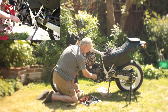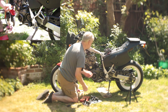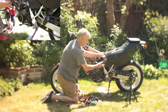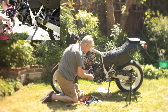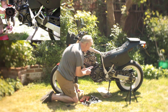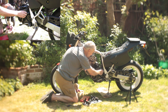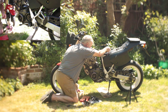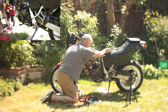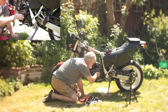I'm going to leave this stator cover off — actually I can put it back on now. This was also very crusty in here and I've put ACF 50 inside to hopefully reduce the corrosion happening again. I need to do the coil pickup first before I can put the other piece on. Coil pickup goes on here.